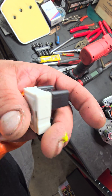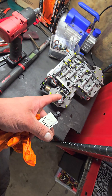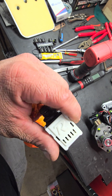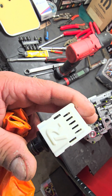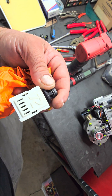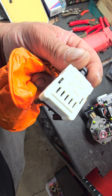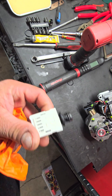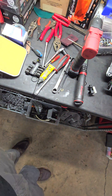This is the end-all be-all for the third gear start problem. The problem is people will put a shift kit in these valve bodies but then use the stock all-black plastic transducers — those cannot handle high-pressure valve bodies. Rostra had a version before that was also white, their HD version, but it was only good for 200 psi and people were still eventually popping them. These new ones are supposed to be the 100% fix for it — just a little tech tip.